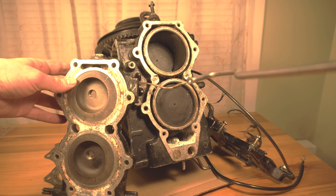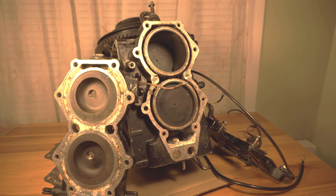That's basically it. You can now understand what the thermostat does and why it's so important: your motor might run fine at slow speeds or at idle with no issues, but as you increase speed this area will get significantly hotter and if it's not cooled you will break your engine. This is also why it's important to have a working thermostat. Some people say you can just remove the thermostat, which is technically true, however this area does need to be at a certain temperature — if you constantly let it cool, the pistons will be too cold and it will shorten their lifetime. Always make sure you have a working thermostat; it's critical to operation and keeps the motor at an optimal temperature. There is such a thing as an optimal temperature — cooler isn't always better, because after a certain point the engine should be warm.